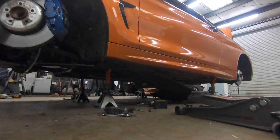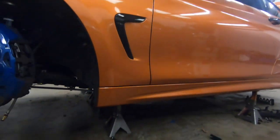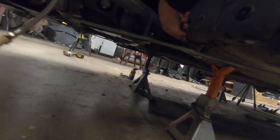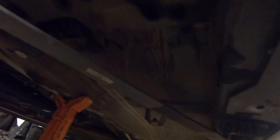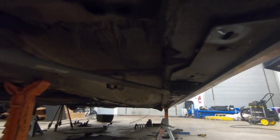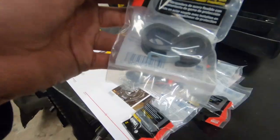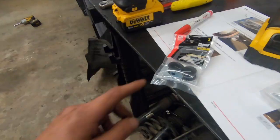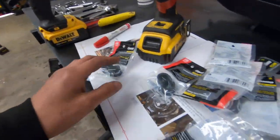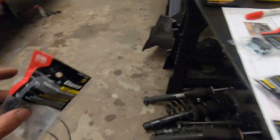On this car there are absolutely no grommets to go through inside, so everything is well hidden. What I'm gonna do is route the airlines back here and then route them all throughout the frame. I'll go through the inside right here because it's out of the way and goes all the way back, tuck it up high and nicely. I went ahead and grabbed some insulated cable clamps with rubber on them from Home Depot, so I can self-tap these onto the undercarriage of the car. I got half inch and three eighths because the air hose is quarter inch, so this should work nicely.